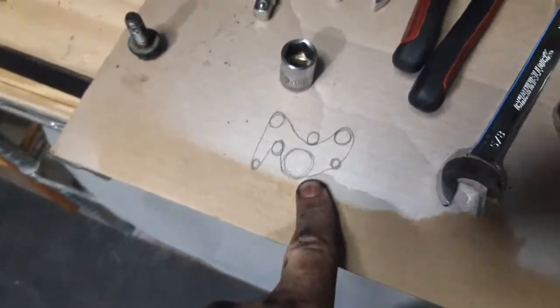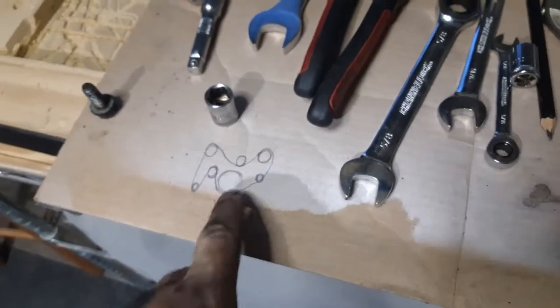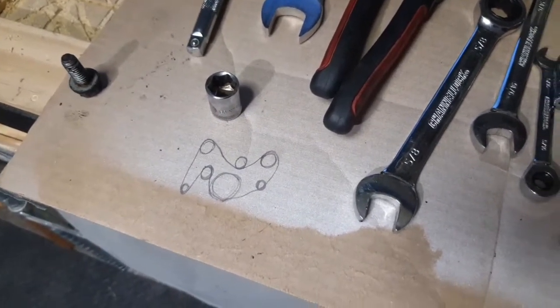I did draw a diagram so I'd remember how — it's a good idea, I always do that just in case. So while I'm sitting here editing this video, I realized that the serpentine belt was on wrong in the first place. I hadn't touched it — that's the way I got it. Originally it went under the tensioner pulley when it's supposed to go over. When I drew the diagram, I failed to realize it wasn't correct to begin with. I caught that just in time. Maybe that's why my belt was screeching.